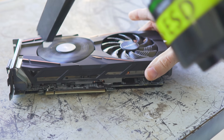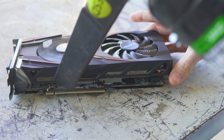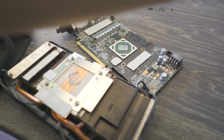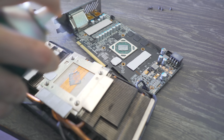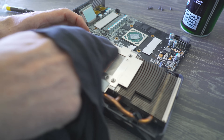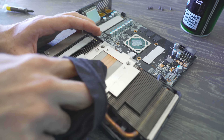You may be wondering why the before and after thermal paste swap didn't make that much of a difference. The answer is simply that this card wasn't that dirty. The person who sold them really didn't use them for that long at all — the dust that came off when cleaning was very minimal. And when we changed the thermal paste, even though it was dry, it wasn't that dry. I've seen thermal paste pretty much crumble as soon as you take it apart; this stuff still had a little bit of moisture to it. So it was still doing a pretty good job — I guess Gigabyte are using decent thermal paste on their graphics cards. Also, the two cards we compared had different coolers, so it wasn't really apples to apples.